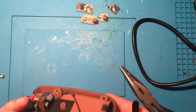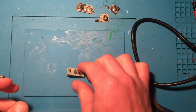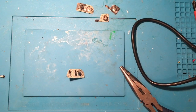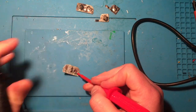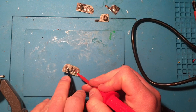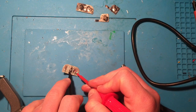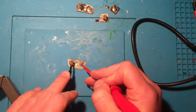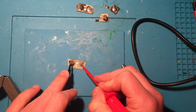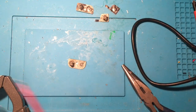The other side is actually pretty good so I'm not going to necessarily worry about that, but these definitely need some attention — that's really bad. Using the multimeter again for a quick continuity test: connecting to some shiny parts gives continuity, but anywhere else — not much. No wonder a battery can't be read. You're supposed to get a connection from there to there and we're just not. This is gonna get a vinegar bath.